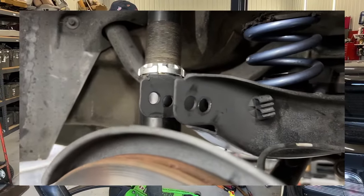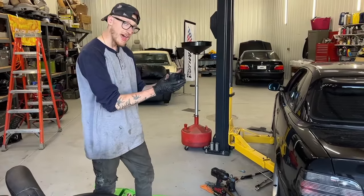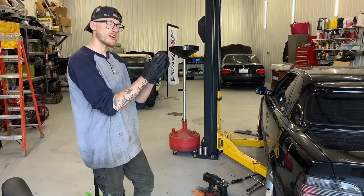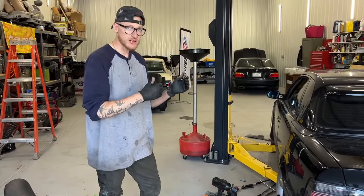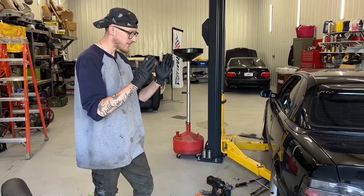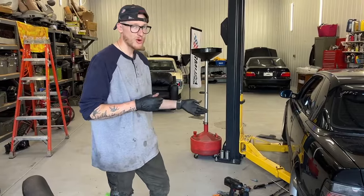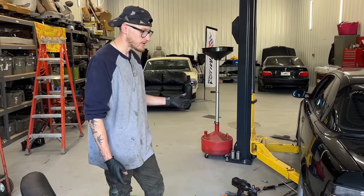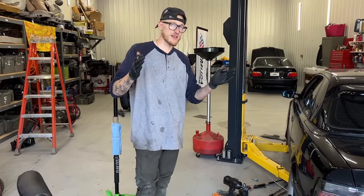What we did: we drilled an inch and a quarter outside-to-outside, slotted the upper control arm by drilling another hole so it mounted inward, and this car had adjustable rear lower control arms which we brought in at the bottom. So we swooped in at the top and swooped in at the bottom. Since he was running axle spacers before to keep his joints taut, we eliminated those and pushed it all back together.